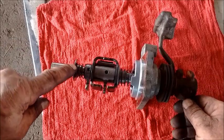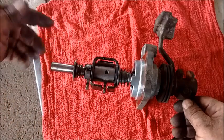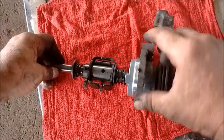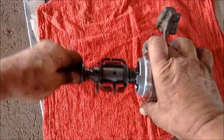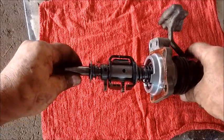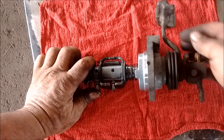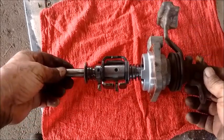Every single element of the assembly has been moved from the front-wheel drive shaft onto this new shaft. This is the reverse block-out assembly, which also has to be purchased. The function of the reverse block-out is to create resistance so you do not accidentally shift into reverse gear while driving. The counterweight is from your MR2 Spyder and is removed from the Spyder's gear selection shaft and placed onto this new shaft.